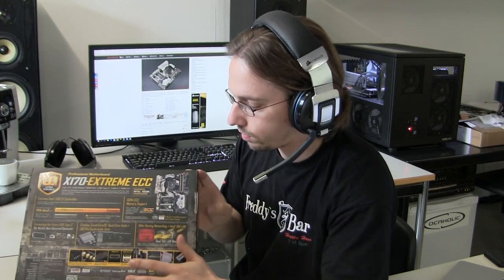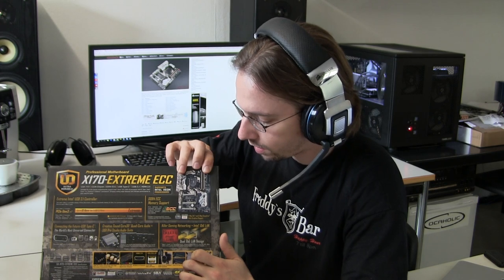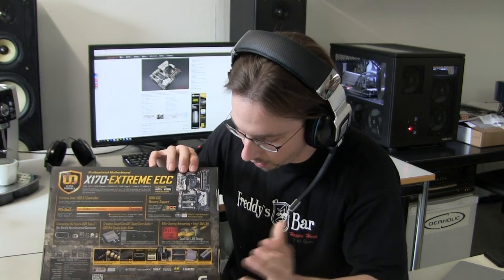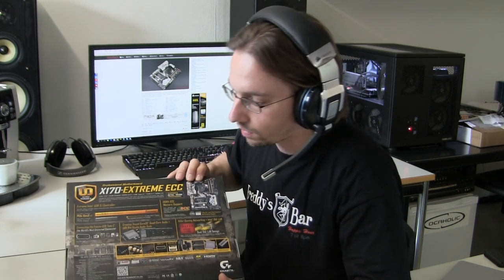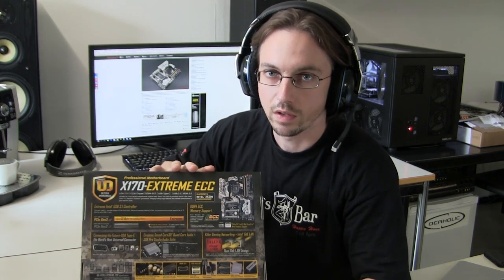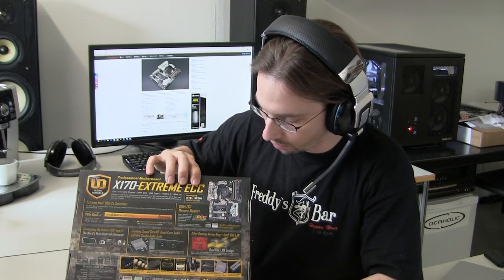The board has solid black caps and a decent power design. Dual M.2 slots are linked to the CPU via PCIe 3.0 with four lanes each, also translating to 32 gigabit per second or 4 gigabytes per second. There's a Turbo B-Clock feature, though I don't quite understand why since the C236 chipset is only compatible with Xeon V5 E3-1200 series processors, which aren't really overclockable. The board also has shielded PCI slots, which makes them stronger and more durable during shipping.